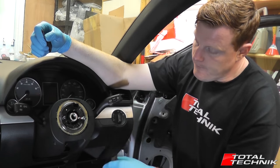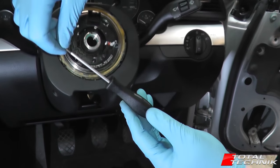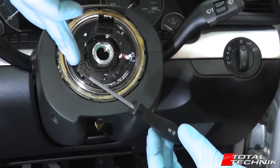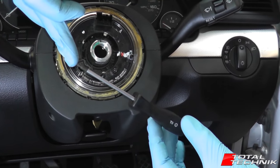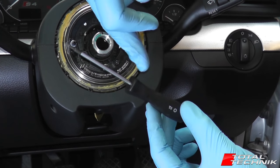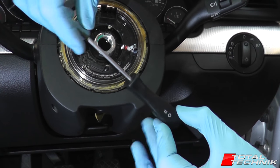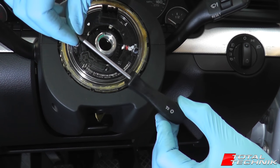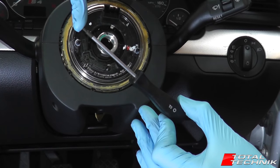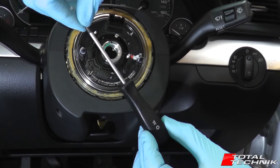The first thing we need to do is there are a couple of Torx screws right in the front here. It's a slightly specialist tool — this is a Torx size 8, which is a particularly small Torx screwdriver. You need to ensure — I had to buy this specifically to do this job, and this is literally the only job I generally do on these Audis that uses this Torx size 8 screwdriver. You need to ensure it's got a fairly long blade — this one is 7.5 centimetres, 75mm in length. That's just about long enough; any shorter and you're going to struggle.